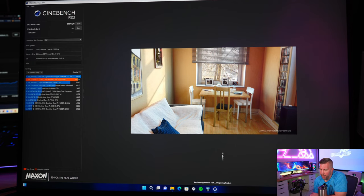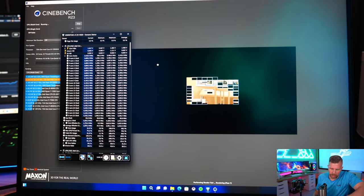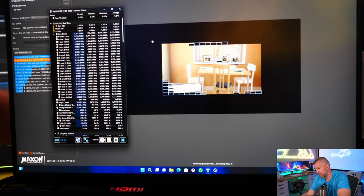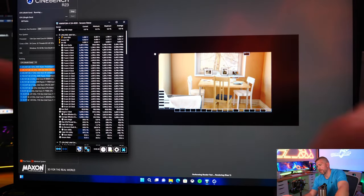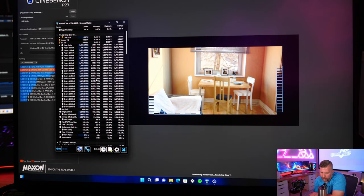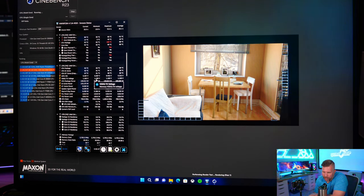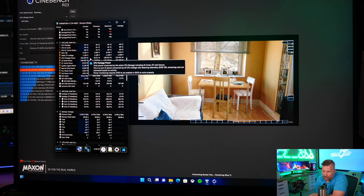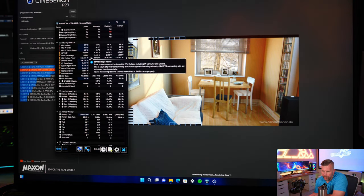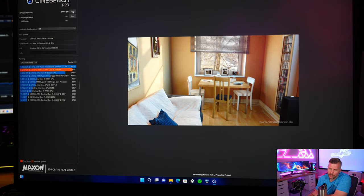That's excellent. Especially for a Razer laptop. It's excellent. I'm also going to raise the back like I usually do for each laptop with my external SSD. Just a little bit of extra airflow that way. All right, so our temps. We have bounced off the 100-degree mark, but right now they're at 86. TDP is 126, 133, 112, 105. We got 27,973 for our second run.